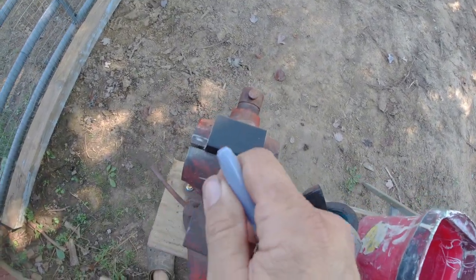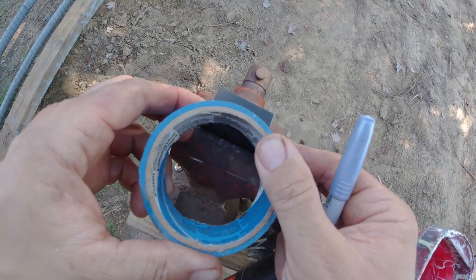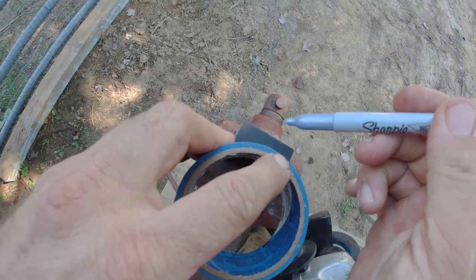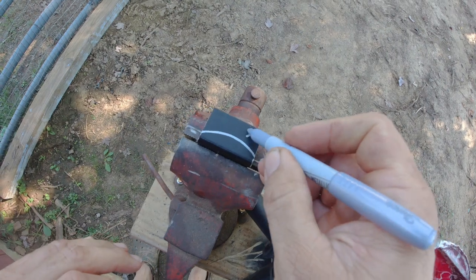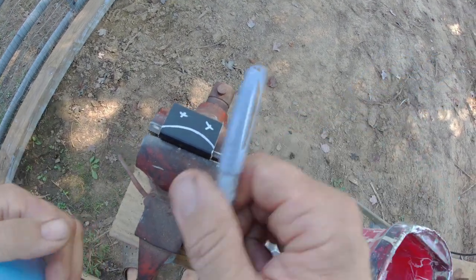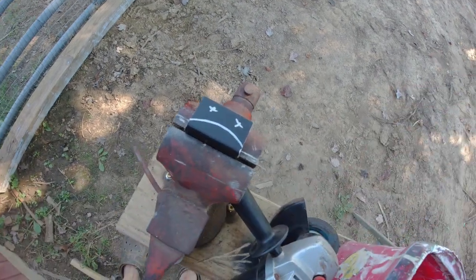I have one side cut that I traced. Now this is the side that's gonna go inside the axle, so I can't have these corners - it'll never fit in there. What we're gonna do is use this roll of tape to make my line here and cut all this off. This will keep the piece from wanting to bend when we start applying pressure to it to get the bearing out.